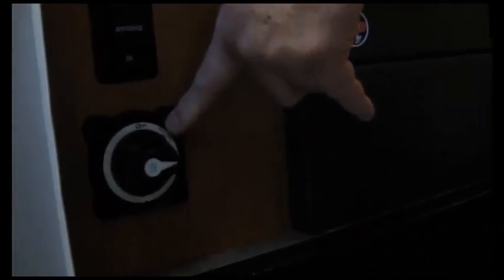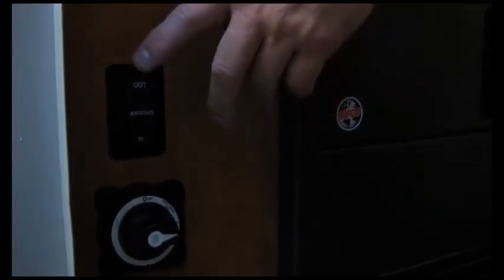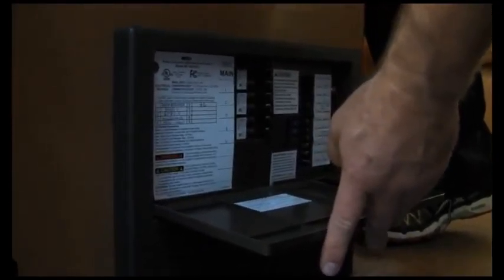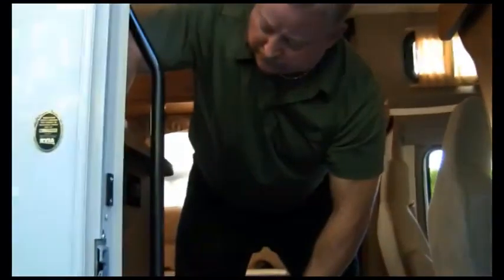Just inside the door, we've got a battery disconnect switch — that's a very common one; sometimes they're electric. You want it on while you're using the coach. Don't turn it off while you're on your trip unless you're getting on a ferry and have to shut everything down. Your routing switch — this is your power converter. Sometimes these are under the bed or under a cabinet. That's your breakers and fuses. If you're tripping something more than once in your trip, something's wrong — seek professional help.